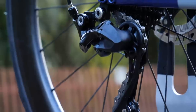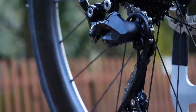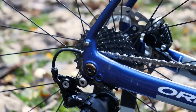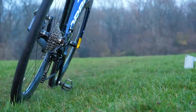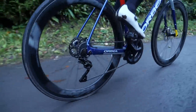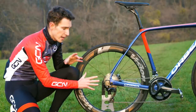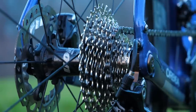It's actually the first opportunity for Shimano to design their 105 mech in the shadow style, bringing it in line with their Ultegra and Dura-Ace groupsets. It means it's better protected against knocks — you know, the ones where you lean your bike up at a cafe only to see it falling over as you sit drinking your flat white. It also apparently makes it a little bit easier to put the back wheel in and out. The derailleur comes in two cage length options, the longer of which will fit an 11-34 cassette.